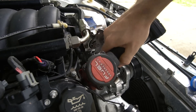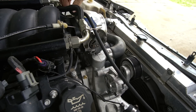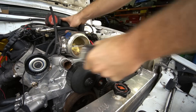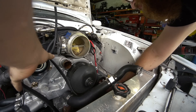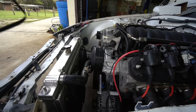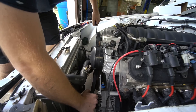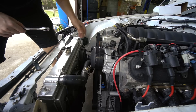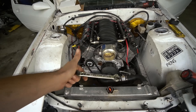Got two belts — at least one of those will work — and the fitting. First one is like the perfect size but needs to be cut down a little. Both of those ended up being too short though; need to go up just a tiny bit. Got one that's a half inch bigger — and there we go, that's a belt, ladies and gents. Bolt, tension, and belt — now we've got alternator and water pump. That's a big step, one missing piece of the puzzle solved.